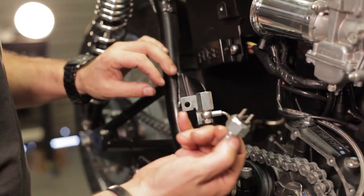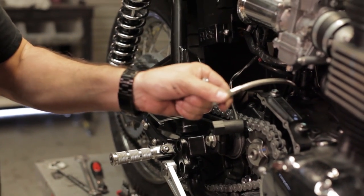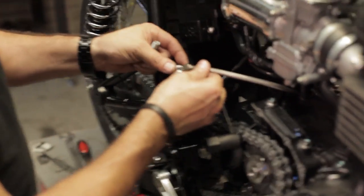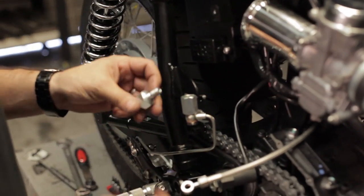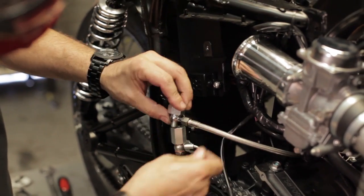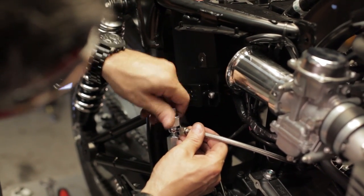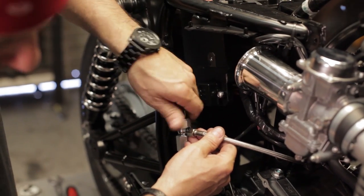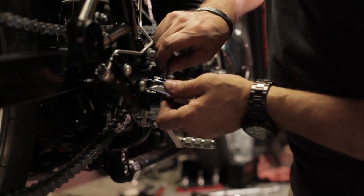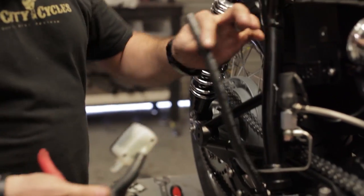This piece is obviously your brake light switch. Once we have this all buttoned up, our brake line to the rear caliper sits here — this is the custom one we put in place with the custom banjo. It's not tight yet; we left it loose so we can jimmy it. You've got a washer here, so your brake switch goes into the bridge like so. That's where your rear brake line connects — obviously without it, you're not stopping with the rear.